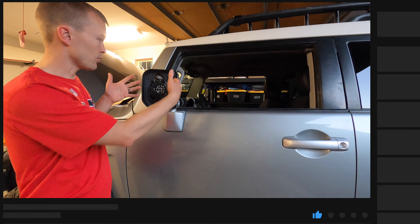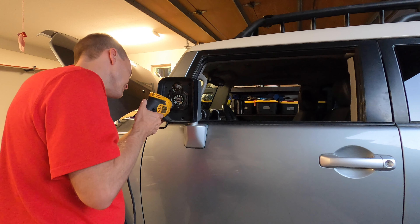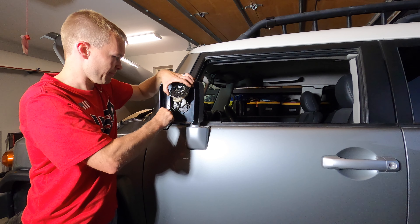We're doing the retrofit kit, so we're going to be taking this all apart. Next, we're going to remove this little plate here. You need either a Phillips head screwdriver or a drill with a Phillips bit. You'll see you've got a screw here, here, and here — three total. And we've got three more screws to remove: one, two, and three. Next, we're going to move this centerpiece — we've got a tab on the left-hand side as well as a tab on the bottom, so we're just going to gently move those tabs out so it's just kind of hanging down here.